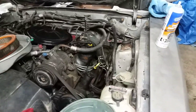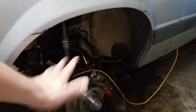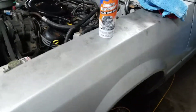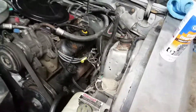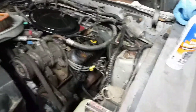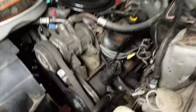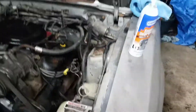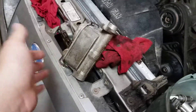So anyways, I decided to throw my brake line in that I've been neglecting down here. I was going to bleed the brakes and all that good stuff, but that didn't happen. I tried to bleed the brakes — there was no fluid that came out, no air, just a little few squirts now and then. So I'm like, okay, the line's probably clogged, master cylinder's probably clogged.